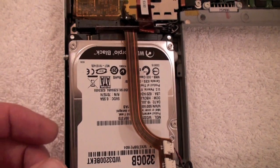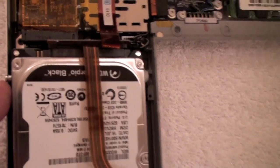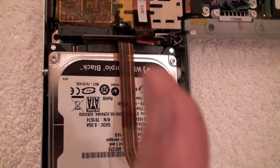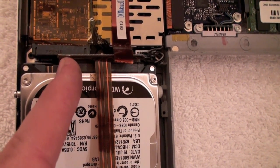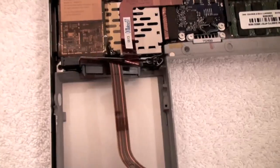This step is a little tricky to do one-handed, so what I've already done is popped out the drive. These are held into place — there's like a little circle inside — so you want to kind of slide it over and then lift it out. There's a little ribbon connector on the top here; you're going to take that off and then the drive will come right out. So there we have it — the drive is out.